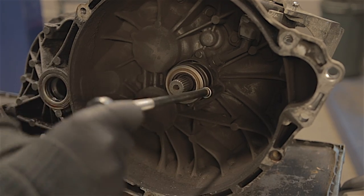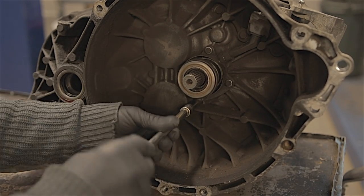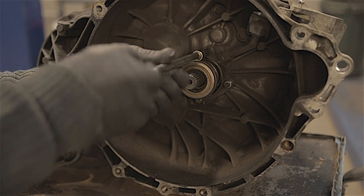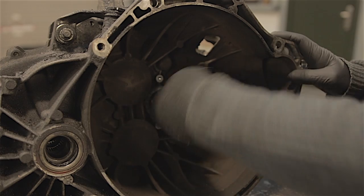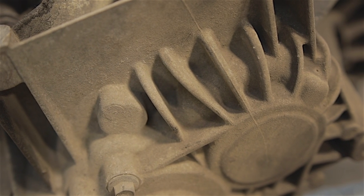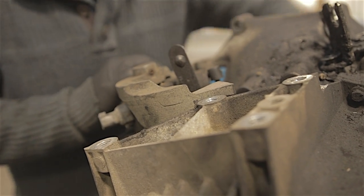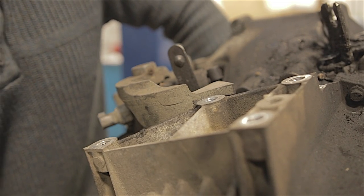Safety first. What I'll do to start with is remove this clutch release bearing, and I'll turn that shaft. It's just with the bearing on the shaft - it's hard to actually get your hand on it properly to spin it - so I'll get these three 8mm bolts out of the way and remove that. The gearbox is in neutral at the moment so I'll just spin this. Yeah, that's noisy. It doesn't sound too clever. I'll pop it into one of the forward gears and now spin it. Hard to tell, but whatever it sounds like, there's a noise coming from the back end here.